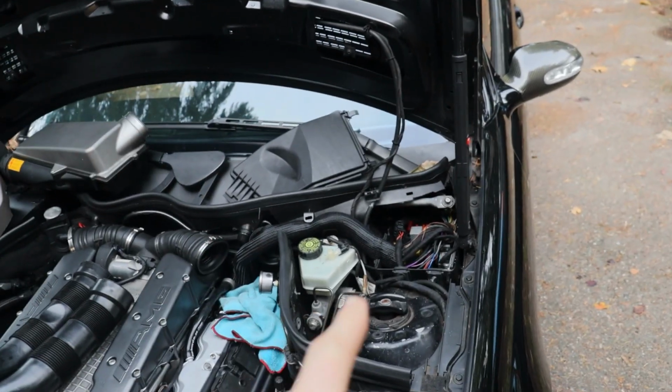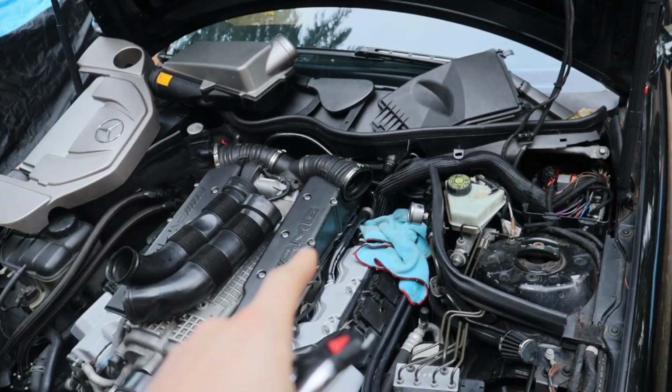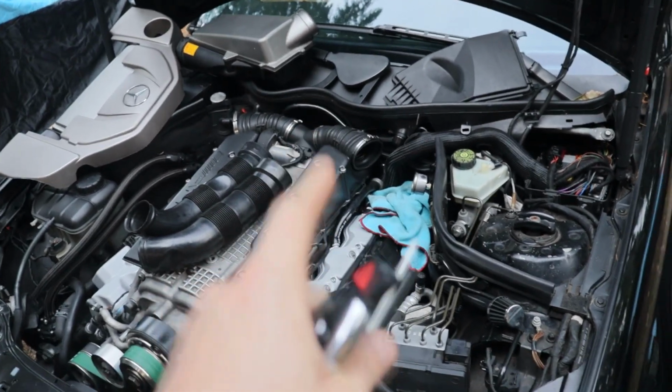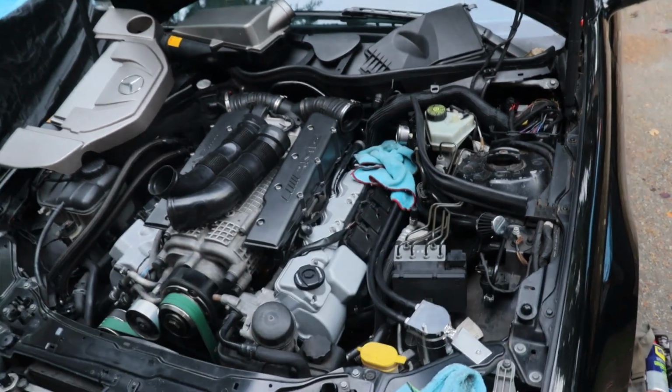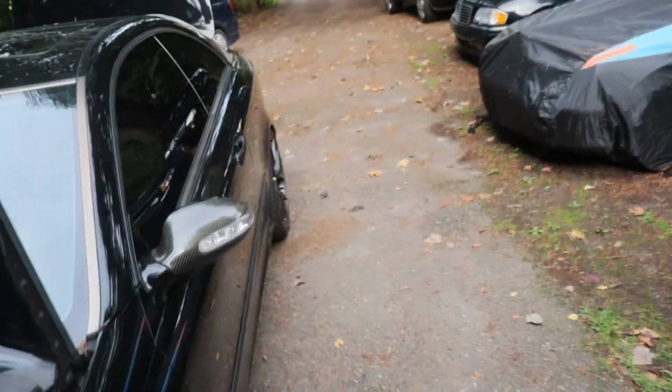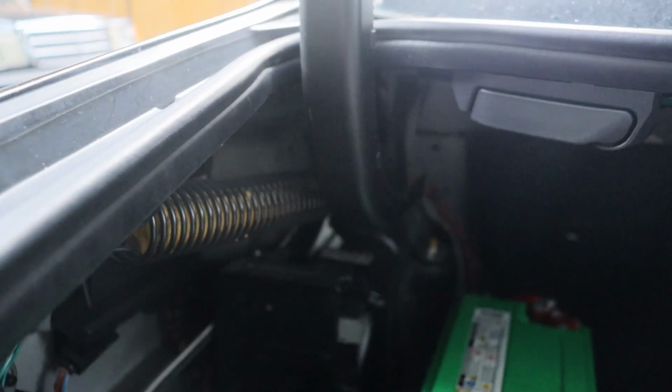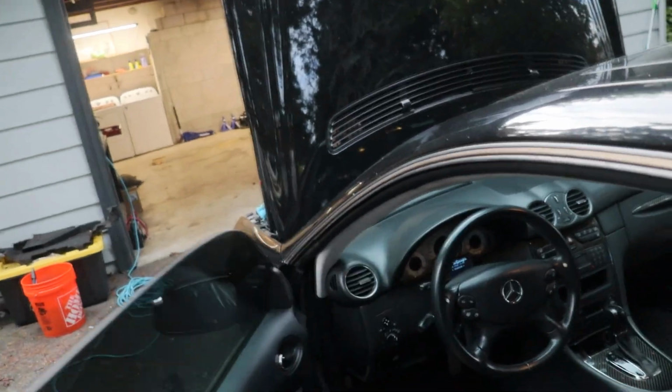Alright guys, we're moving on. Wiring is all tucked back together. I'm going to test out the Schrader valve now to see if it's air or fuel coming out when I turn the key. So plug the battery back on and cycle the key to 2nd position. Get the fuel pump turning on, and then we will see if we got fuel or air at the front.